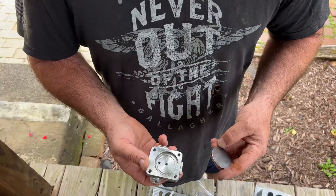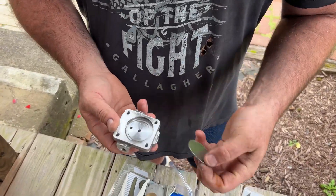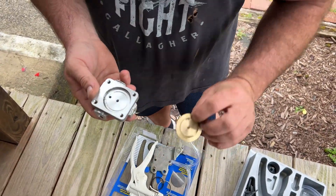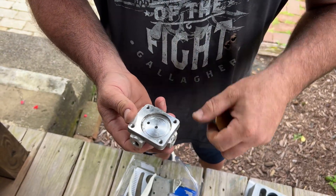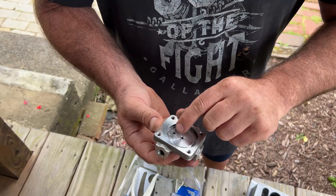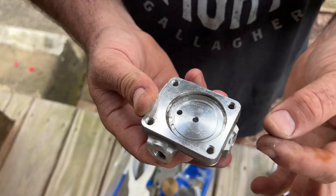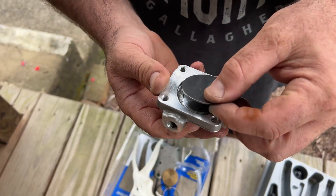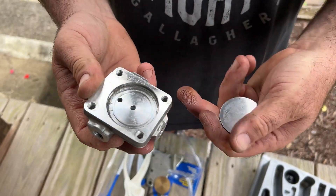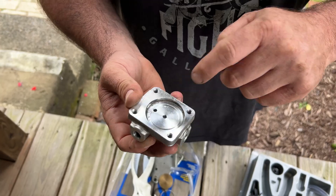Alright guys, let's hop into this install, see what it's going to take, see if it's hard. So here's where we're at — we took this plate out. Now Trent is going to use this replacement plate, which has a concave thing for the fluid to come out of. I'm going to grind this piece out between these two channels so the fluid can just transfer over there and not be smashed between this plate. That plate smashes the fluid and restricts the flow. I'm going to grind this out so the flow stays the same as these two channels.